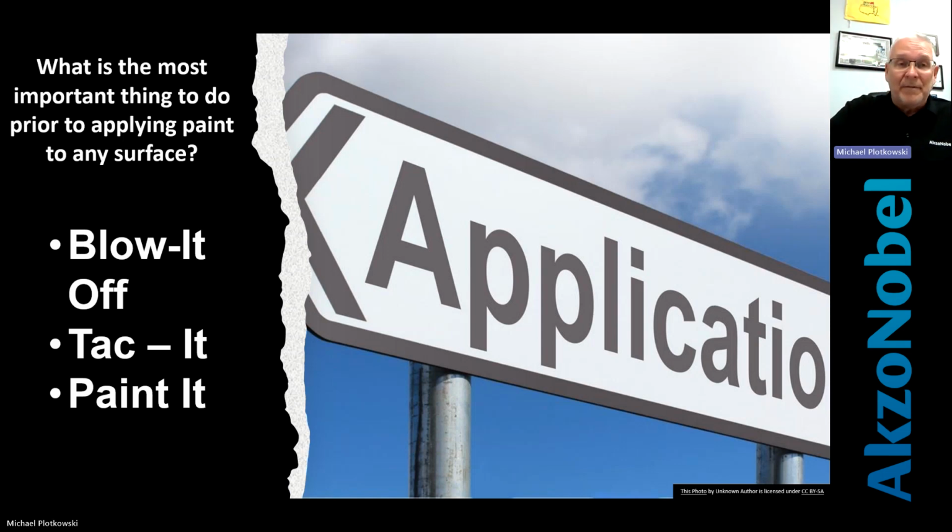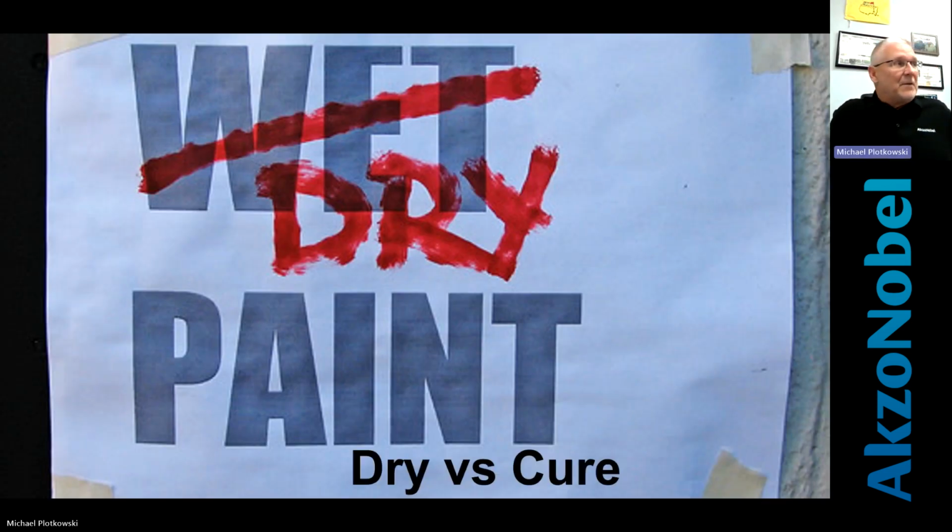So we've got to this point, we got it painted, and the production manager's out there. This has to go by 4 o'clock. There's a difference between dry and cured paint. Most of you know we don't apply vinyl on a freshly painted surface for a certain period of time. Some of you have bake ovens, and yeah, it feels dry. It's ready to go. And they go over there and build it. And the guy takes a drill, putting a screw in, and scratches it right across the face. Right. That creates problems. You're going to scratch it whether it's dried or cured.